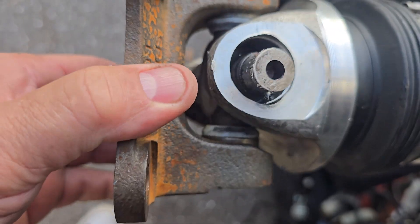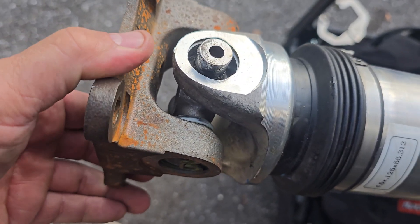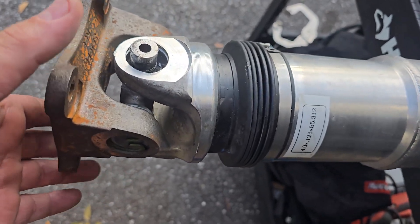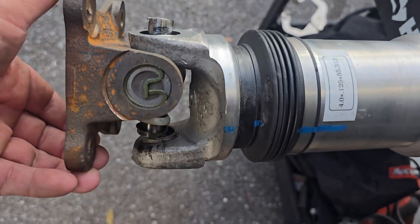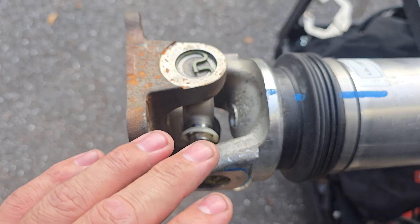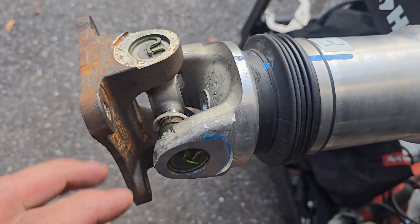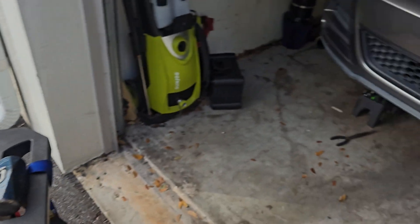This thing must have just let go at 120 miles an hour and vibrated like crazy. At one-to-one shaft speed versus 6,750 RPMs — just do the math. For those of you interested as to what happened: the driveshaft failed catastrophically, vibrated forward, the transmission case broke, and the back of the motor has a couple of cracks. I'm going to try to do my best to get everything apart today but I am wiped out — tired of working on cars all weekend.